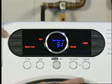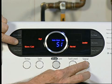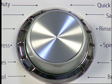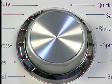To access this test mode with the power on, press Signal and Extra Rinse for three seconds until you hear the beeps and zero comes up on the display. Press Silver Care — a small 'd' will appear in the display. This indicates that you are in the diagnostic mode. Rotate the selector knob clockwise to view each fault code stored in the memory.